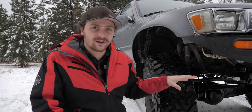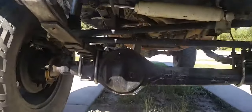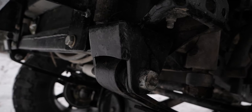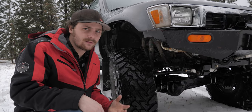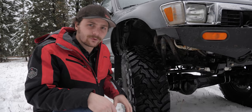My solid axle swap is actually kind of unique because the hanger is normally welded below the frame below the front crossmember, but we cut out the front crossmember and put the hanger up higher to try to keep the truck a little bit lower. Inside the solid axle there are stock 4.56 gears that came with this truck, and there's also a Toyota e-locker.